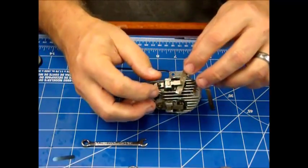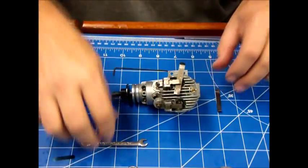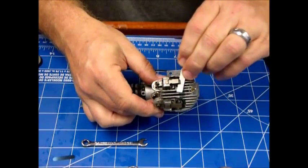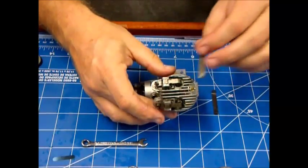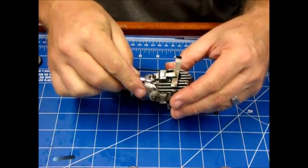This one feels like it goes in pretty easy — I'm going to go ahead and adjust this one just as a demonstration. I noticed the 0.1mm didn't go in, so technically this could go as-is. Let's check this one — yeah, it feels like there's a little slop there. I like to have it so that they're just nipping that a little bit.